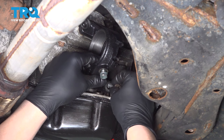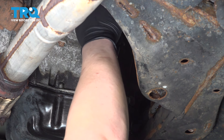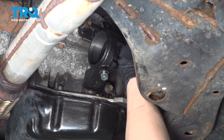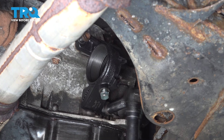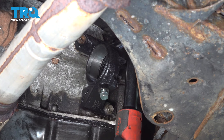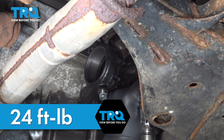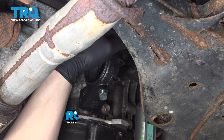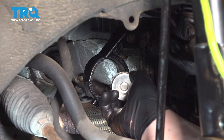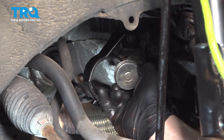Install the bracket onto the car. Get your bolts started and snug the bolts down. Torque these bracket bolts to 24 foot-pounds. Using a bit of grease, we're going to go around the inside of this bracket and totally cover it — we're trying to avoid having this new one rust weld in so hopefully it'll come out easier next time.